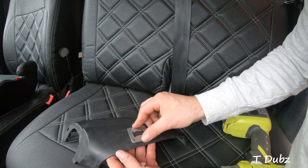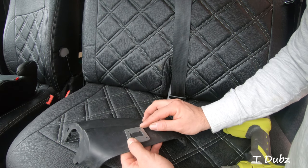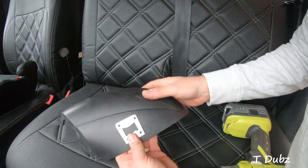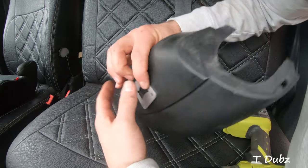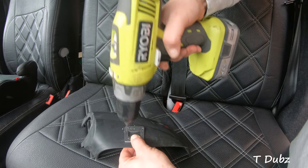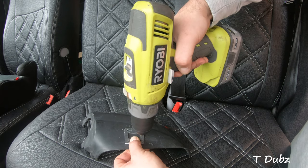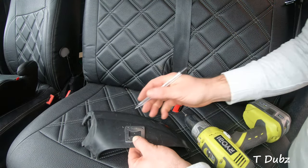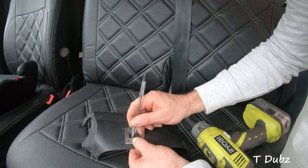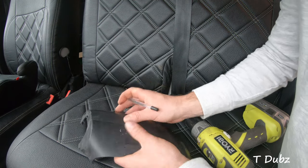I'm going to go for around this area — it's the flattest part of the wing mirror. Obviously when I've riveted this on there'll be a slight bit of movement beforehand, but I'm hoping the rivets will clamp that shut. I'm going to work out which way I want it to go — I believe it's that way. I'll do the holes for this bit first, then mark out on the plastic the area that the opener needs, just scribbling all over it so I can see it.